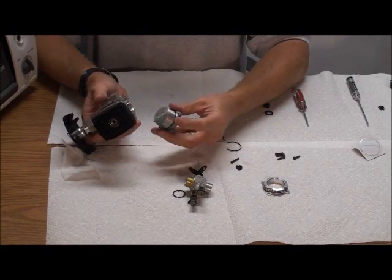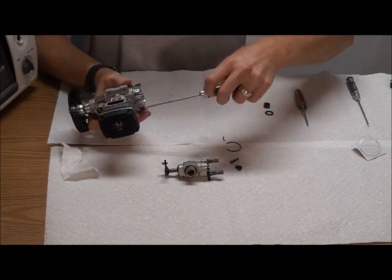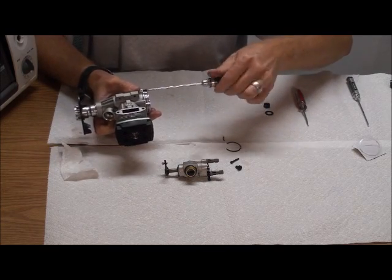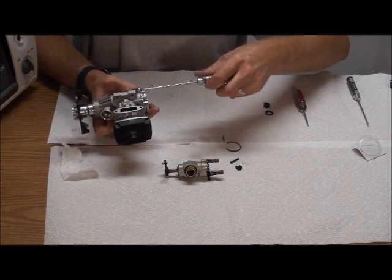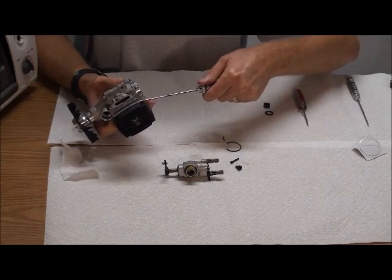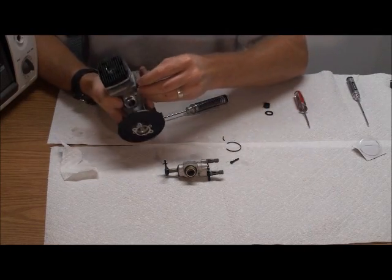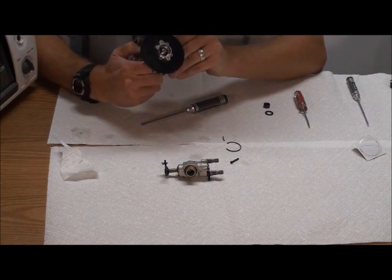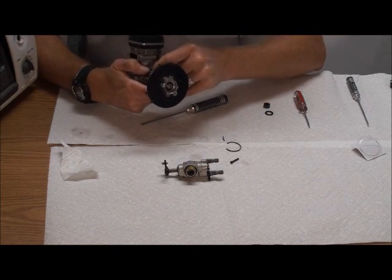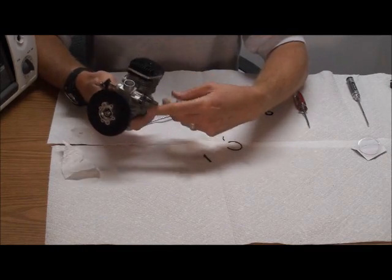Now for the back plate — again, make sure the O-ring's there, simply put it into place and tighten it down. For the back plate, I'll tighten it in a similar star pattern as on the head, but it's not nearly as critical. I'm not really worried about the seal in the same way as on the head of the motor. Then for the carburetor, once you have the back plate down, just make sure to reinsert the pieces that connect and clamp the carburetor in place. The main issue is actually lining them up so they sit properly. Once that's done, just set the carburetor in place, tighten it down, and your motor's all done.